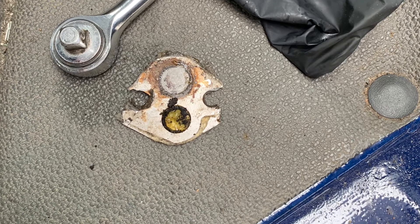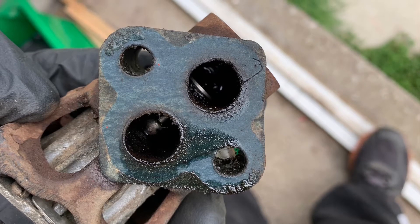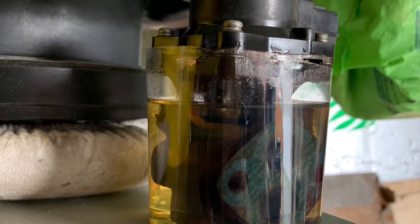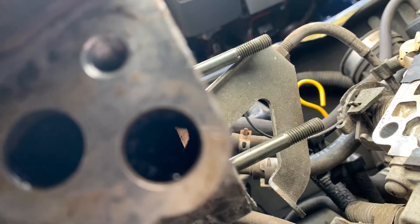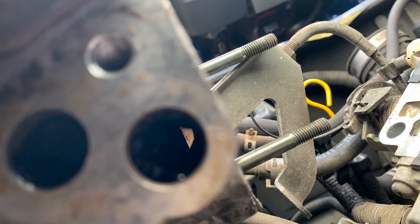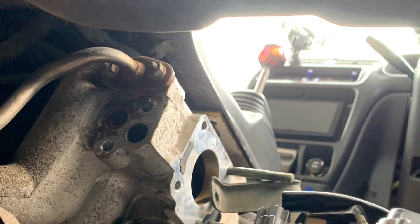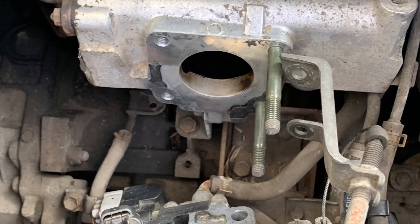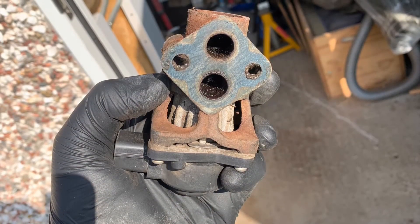The van is about 19 years old and as you can see it was really coked up. I started cleaning it out with some EGR cleaner and some petrol, trying various solvents to clean it to be honest, but it wasn't really getting very far. The actual valve being blocked wasn't the only problem - the actual engine was all coked up. All the manifolds coked up, so I was spraying solvents in there and using pipe cleaners to try and get it as clear and clean as I could.